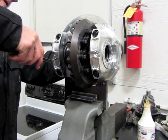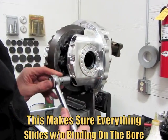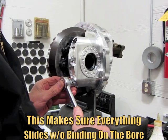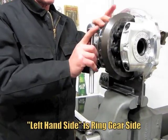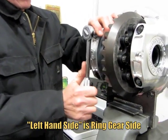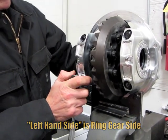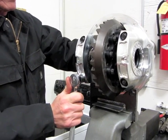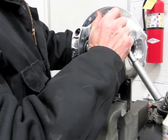We'll read that later off the pinion. I always like to loosen the caps just a little extra, give her a couple taps. Always tighten down your right-hand side first. If you tighten the left-hand side and you don't have sufficient backlash, you'll end up locking it up and you have a good possibility of actually bending the ring flange of the spool.